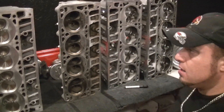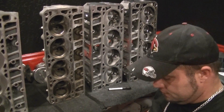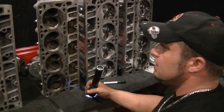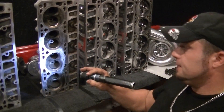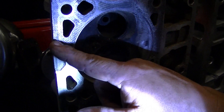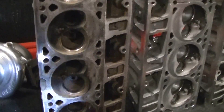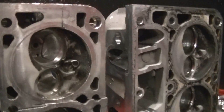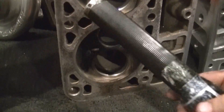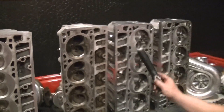Here's the trick: people will call me up and say their heads leak. Well, there's a reason why they leak — these take a graphite gasket, these take an MLS gasket, multi-layer steel. A lot of people don't know about this notch right here on the early LS heads — that's why you have to get this specific gasket for it, because it has something right there to make sure it doesn't leak. There is no portion of that here. This is an MLS head and this will take a graphite gasket as well. That's why your early style heads leak when you put that MLS gasket on it.